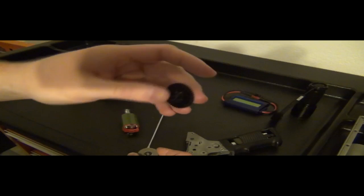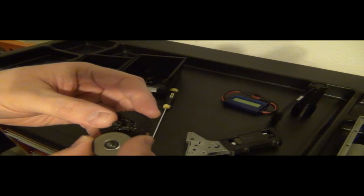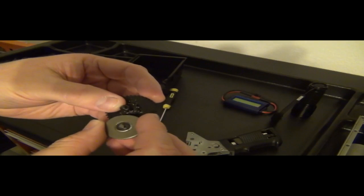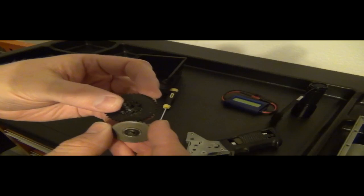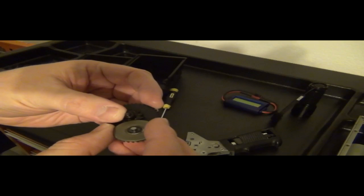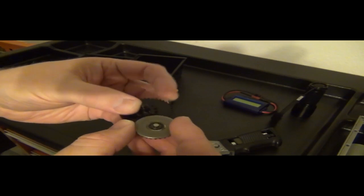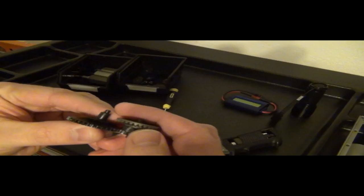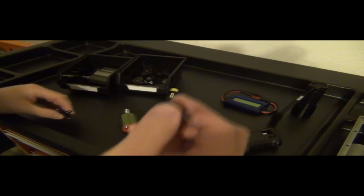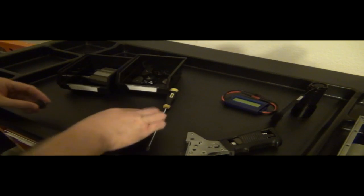Here's a Siege Tech spur gear, and if I put this in the teeth here, imagine me bounding this up. So if I was to put pressure here, is this supposed to spin like that? No. Same goes the other way, but this does not happen this way. When you put the pinion in, all it does is push the bevel up like this. Sometimes it's a little bit lifting, but it usually pushes it up like that. So if I'm looking at you, this is what it would look like if I was to push the pinion right here up. Now, what people do not understand is if it's in the gearbox like that and you close it, it won't look like it's pressed up.